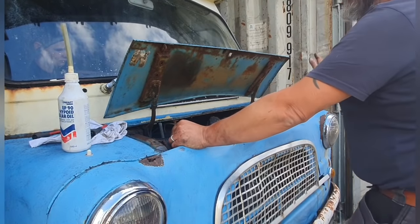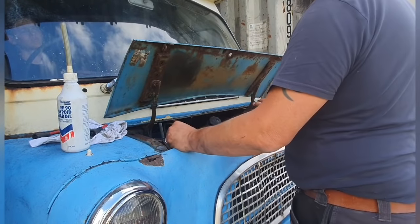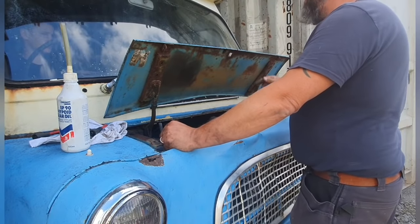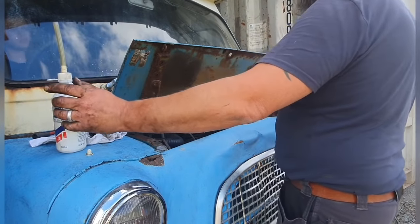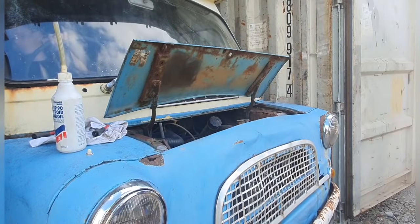Yeah. Right, stop. Okay, what we need to do is get a temporary fuel line hooked up to the carburetor with my little tank up here. So if it does run, at least it will run for a little while, because I don't want any of this manky fuel going in there, and I can't feed it with this. We'll have a fire. All right? So we'll get that set up, and we'll be back.